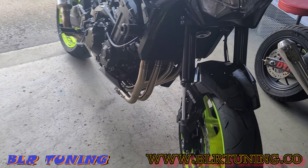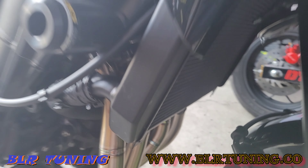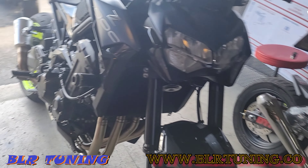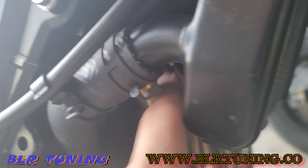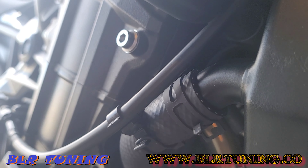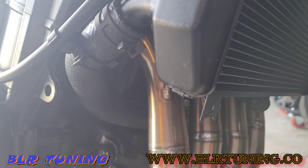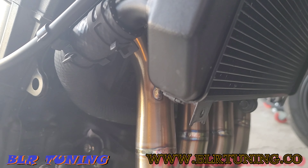The exhaust stud nuts — those are these nuts up here, two on each cylinder — are going to be 16 foot-pounds or 192 inch-pounds. As far as those metal flanges go, your spring is going to be up on the top corner of these two. Looking at it from underneath, it's on the top left-hand side, which would actually be the right of the bike — so if you're sitting on the bike, it's the right-hand corner on both of these. The numbers on this flange face up towards the motor on cylinders one and two, and down towards the ground away from the motor on cylinders three and four.